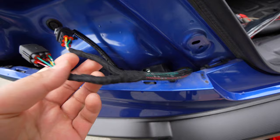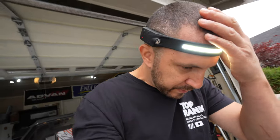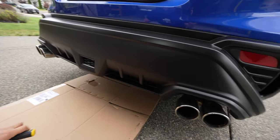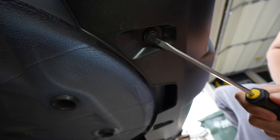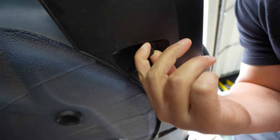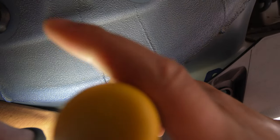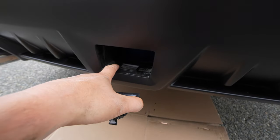The wiring harness is very nice — it's OEM quality style. Now we're going to get underneath the car. I've got my headband light on and we're going to use a flat head to pop up a couple of the clips from the underside so we can maneuver the bumper out a little bit to get to the rear of this plastic piece. Once you get your clips out, you can look underneath and see there are a couple of little black clips that you can just depress upward. You can see those little clips are just being held right there.